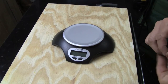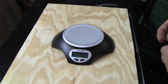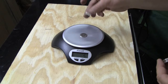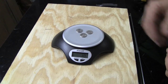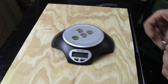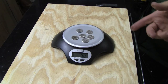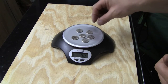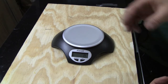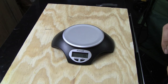I was concerned that after all this bending of the strain bar, the scale would be out of calibration. So I zeroed it — nickels are five grams apiece, so I'm going to stack several on here. The first one says five, ten, fifteen, twenty, twenty-five, and thirty. So you can see the thing's in pretty good calibration despite me bending everything. I just use this to weigh food, so it's nothing super accurate. It went back to zero, so everything appears to be fine. Hopefully if yours quits working, you can use a similar technique to get it going again. Thanks.